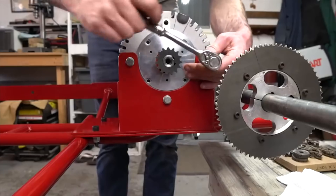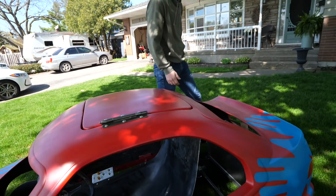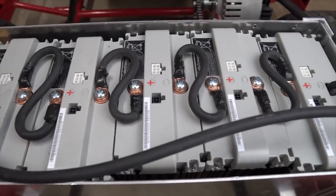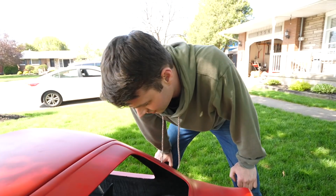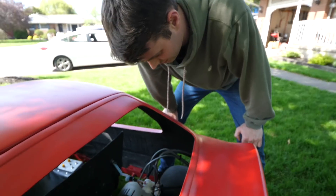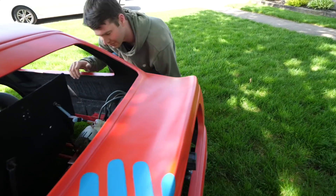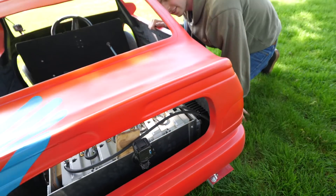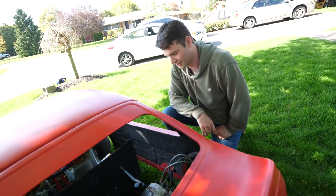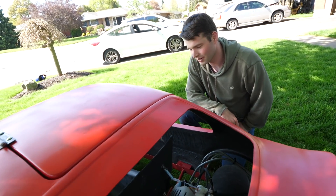I have a lot of batteries in the back. It's a 48 volt brushless DC motor, just over six horsepower. And I have a 350 amp peak controller from Kelly Controls — about 150 amps continuous. So it's got plenty of power. What is that in kilowatt?